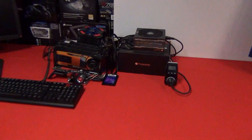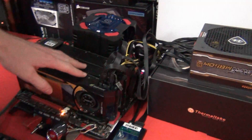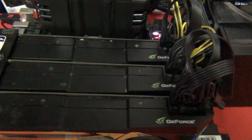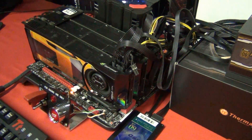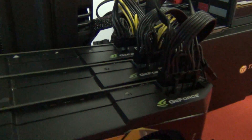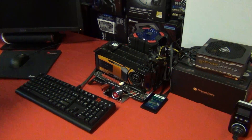Now we'll install this in a system with three GTX 580s on Socket 2011 with an SSD and fire it up. First thing we noticed is that this power supply can't easily run tri-SLI with dual eight-pin cards — we ran out of six-pin connectors. It only comes with four PCIe connectors, so we used the two built-in ones for the eight-pin connections and had to use adapters for the remaining two. If you're SLI-ing lower-end video cards with single six-pins, you could probably get away with it.